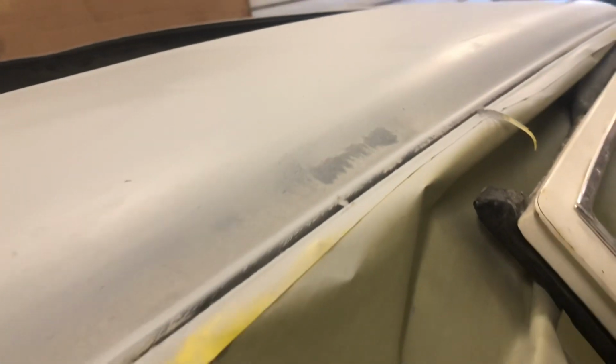Still need a few more coats. Y'all can see some wet, some dry. You still see greenish, but the sides need to be feathered on the edges here and there. But other than that, man, pretty straight. Still wet here and there. There ain't too many spots on the front, but all in all, it's gonna soak up a lot of primer once all the bodywork stuff is done. Kind of dirty.